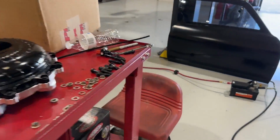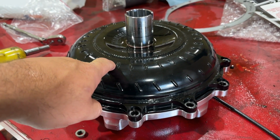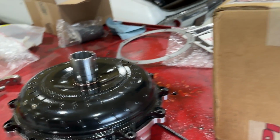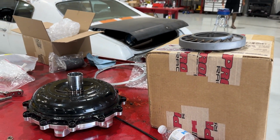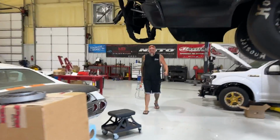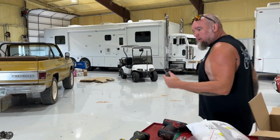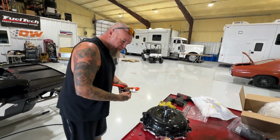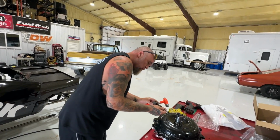So, going to the stator that's in here, we've ran all season. But, you know, when you're testing, you try new things. So we're gonna try something a little bit different here. We've talked about stators for years, and we've talked about on not so great surfaces, looser stators work better. And that's what we're gonna try. We feel like we could go faster if you don't have to worry about the stator being tight and trying to kick the tire off all the time.